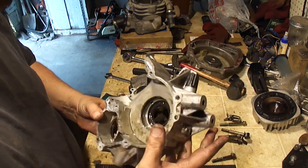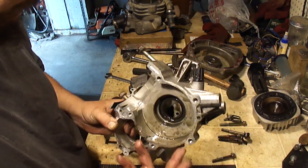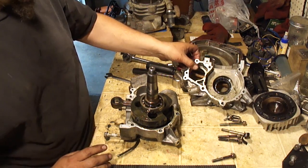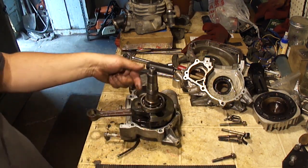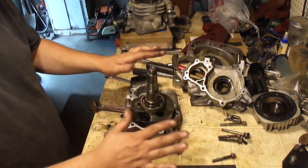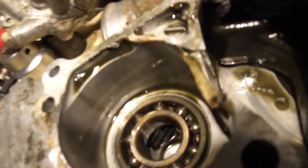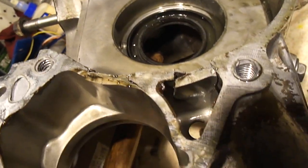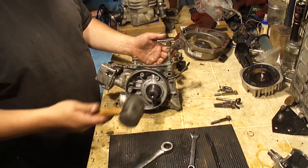Okay, now here's the issue I was talking about — the crankcase is destroyed. Something must have gotten in here and destroyed it. This happened more than likely before I got it. There's no clearance. If something like this wrist pin clip fell down in there and then you ran it, this would do that — along with a multitude of other parts that could drop in there and damage the case. This is where all my balancer shaft oil is going. It's also cracked right there.